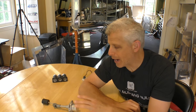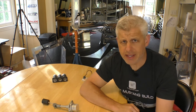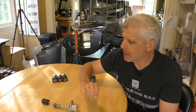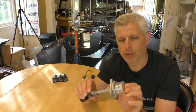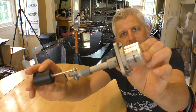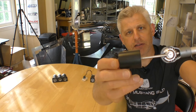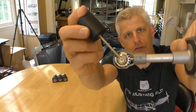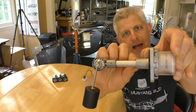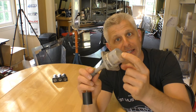I'd like to show you how these systems work and how you move up to an electronic system. There are a variety of different types, but this particular one is a resistive system based on a float. You may wonder what is actually in this mechanism — what connects this plastic section with the wheel that shows the level, going around to this float? It all starts here with the float. There's a toothed gear that actually moves and turns it into rotation of this axis — a shaft that runs in here. You might wonder how you keep fuel from coming out, or whether this plastic gets filled with fuel.